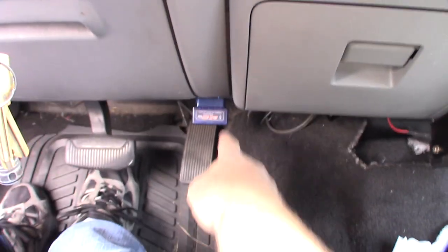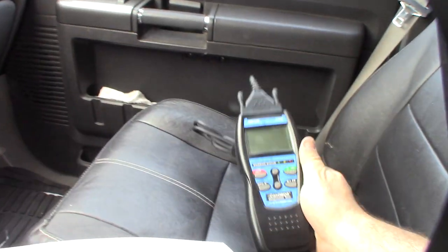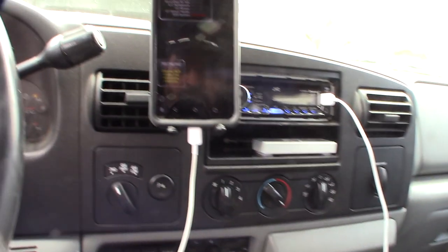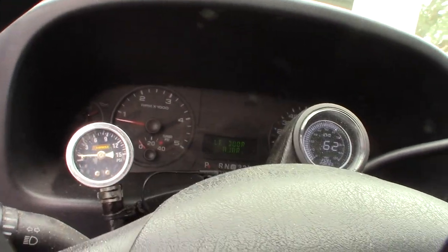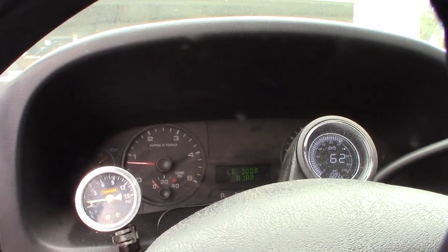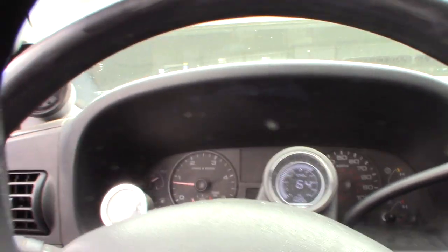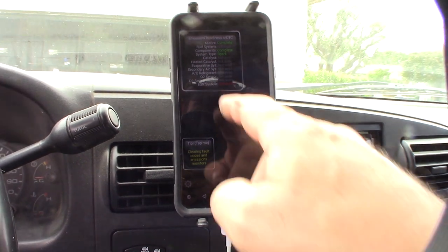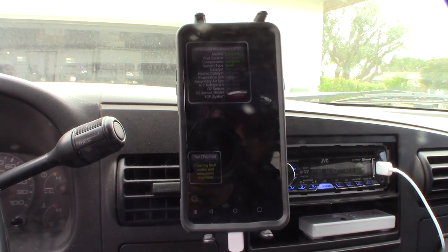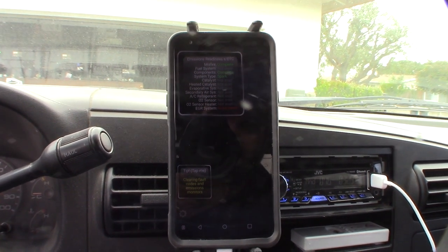I'll put a link where you can get the ELM 327 adapter to make it run, or you can get an OBD scanner with an emissions readiness function. What's crazy is, even with that stuck EGR valve, I don't have a check engine light — so you wouldn't know you have a stuck EGR valve unless you took it apart. No code. What would happen is it would just always stay incomplete with the stuck valve. So if you're not able to complete the EGR system, take your EGR valve out and clean it.